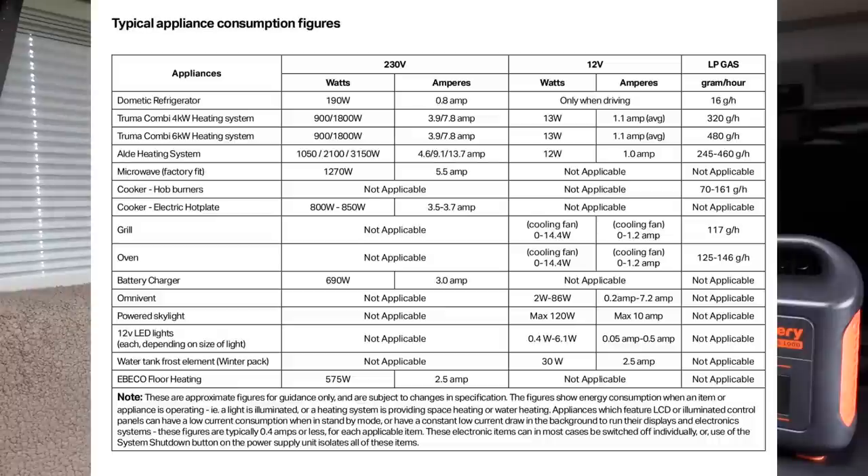So it's not really for charging motorhome batteries and running off-grid. Looking at the motorhome manual, the battery charger takes up to 3 amps and the fridge takes 0.8 amps, so in practice it may be useful for an emergency top-up of the batteries, but every other 230-volt appliance would have to be off. You certainly couldn't run the heating in the van off this, as even on its lowest settings it runs at 4.6 amps. So off-grid, this is most useful for the occasional toaster or drying your hair.